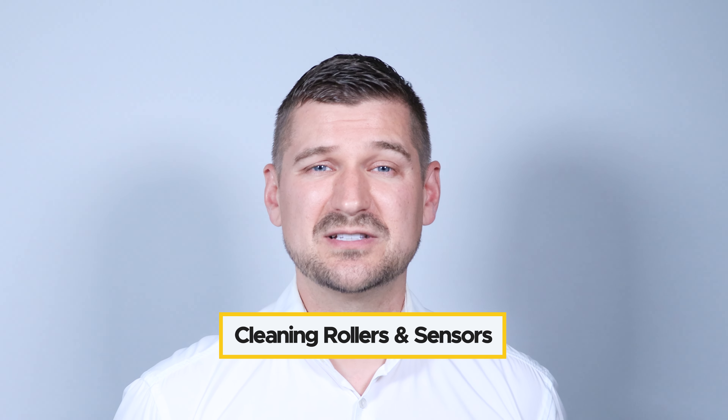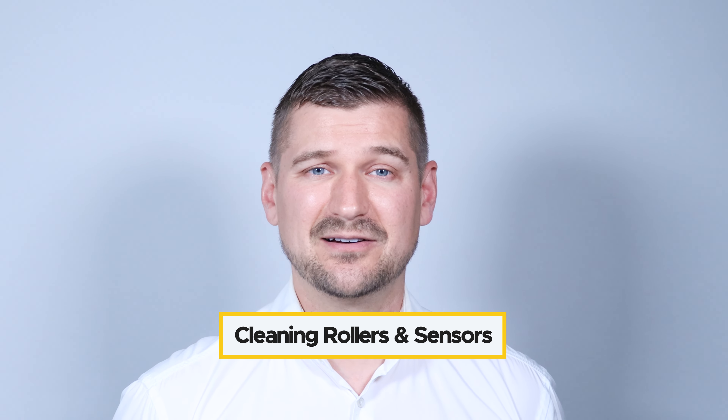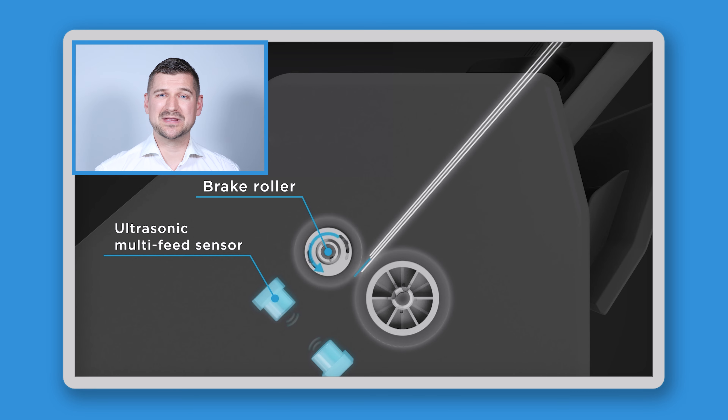In addition to cleaning the glass, you may also sometimes find that you need to clean the rollers and sensors inside of your scanner. The rollers move the documents through the scanner and the sensors provide the scanner with information about this movement and the documents being scanned. Depending on the kind of scanner you have, there may be a few or many kinds of rollers, like brake rollers, feed rollers, eject rollers, pick rollers, and others. There may also be different kinds of sensors, like document sensors which sense location, and ultrasonic sensors which sense paper thickness and detect when multiple documents are inadvertently fed through at the same time. You don't need to be an expert on rollers or sensors when cleaning your scanner — all you need to know is that you don't want any loose dust or debris inside, and if you find any, follow the same steps for cleaning the glass: power off, unplug, and use a clean cloth to gently wipe the rollers and sensors.